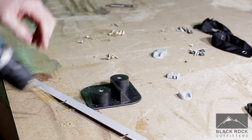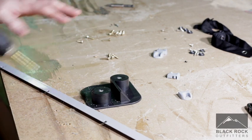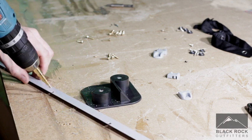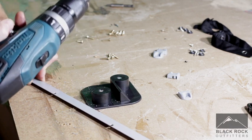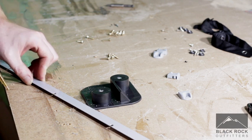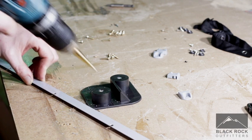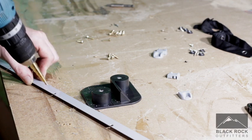Good news - the track fits absolutely perfect in the van, no tweaking needed. What I'm going to do now is tidy up the back side of the track. When you come through with a step drill it can leave a bit of a burr on the back, so I'm going to tidy these up and then join you in the van to drill pilot holes and get the track fixed in.